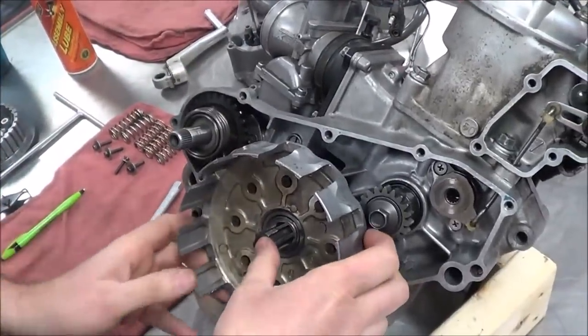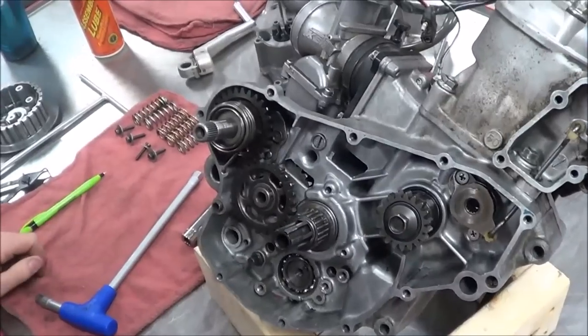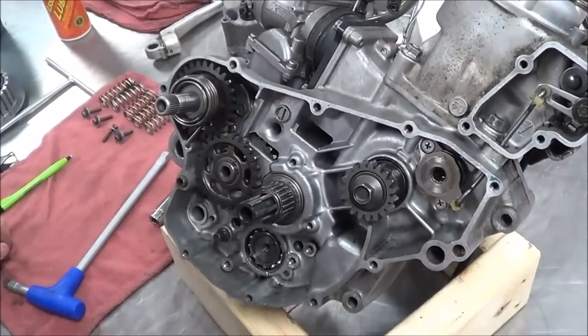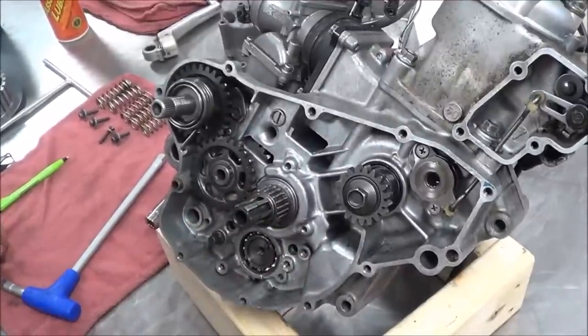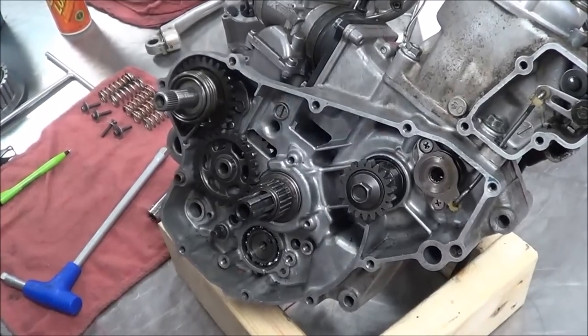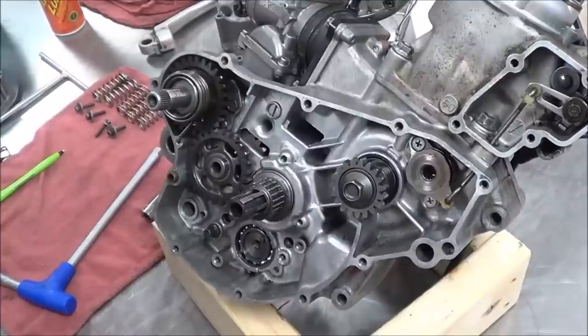When you kickstarted, how fast is it rotating? Chance, that's a great question. What we have is, no one has specifications to say exactly like this dirt bike kicks over to a certain RPM. From what I've either read or been told, it's somewhere around 600 or 700 RPM. And we need about 950, an engine will about stay idling at around 900 RPM.